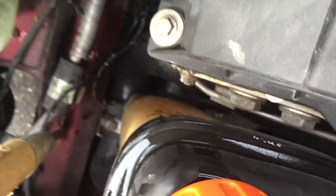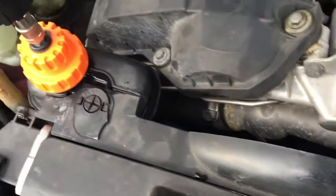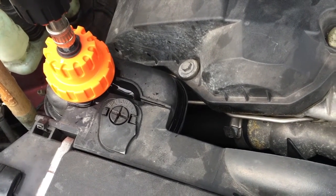You could see coolant coming out from around there and the top of the expansion tank would just ooze out. So looks like I need to get a new expansion tank — I didn't see anything coming out from anywhere else, but at least I know where to start. I'll be getting one of these tonight and just go ahead and order the part.